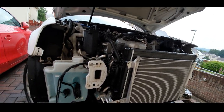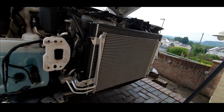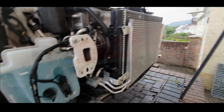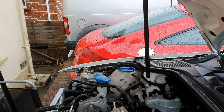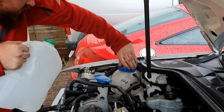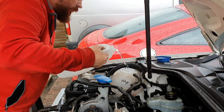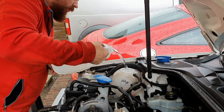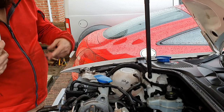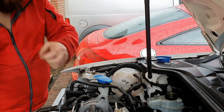I'm going to just put water in now and fill it up, but I'm only trying it — I'm not putting antifreeze in or anything yet, this is only a trial run. It's a self-bleeding system: you get the engine running and it will circulate back out with the cap off, so it should bleed itself.